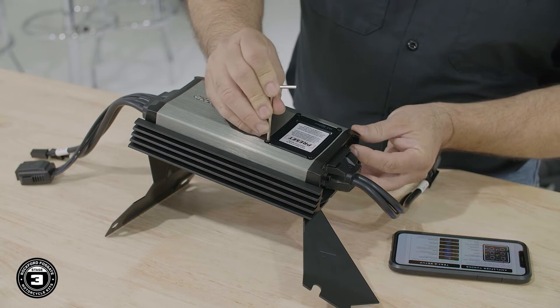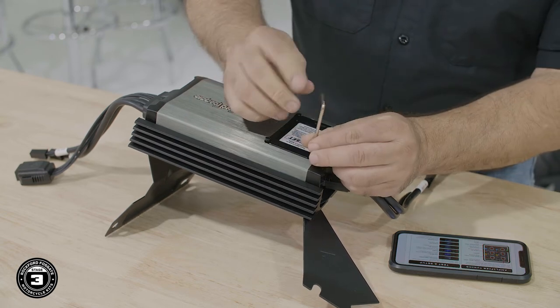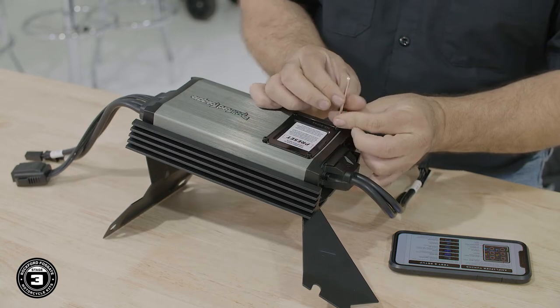Now we're ready to tune our amplifier. We offer an amp tuning guide that's available in the description of this video and through this kit's product details page at rockfordfosgate.com. There are three options for tuning the amplifier based on the radio that you're using. To get started, use the included Allen wrench to remove the smoke cover. Then use a small flathead to make the necessary amplifier adjustments.